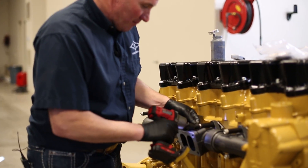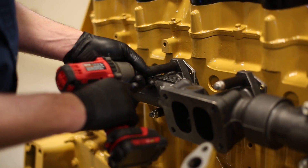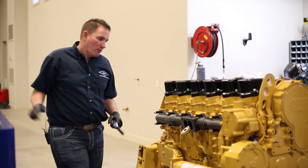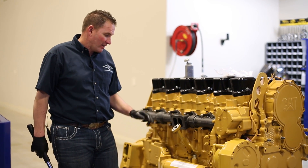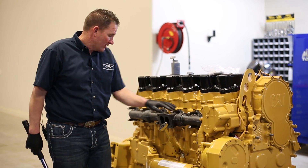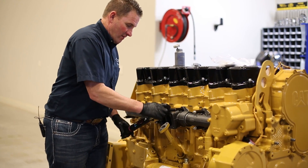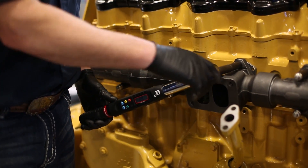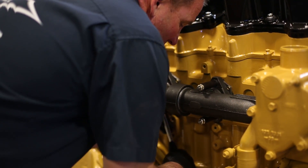Now we're going to run these in a little bit with an impact. We're going to torque them in a certain sequence to 40 foot-pounds, starting at the first one, going to the hand-tighten position, then proceeding across all remaining nuts. As you can see, the impact did not tighten them to the correct amount, so you always need to torque them with a torque wrench. Unfortunately underneath you can't reach a torque wrench, but you can get a wrench on it.